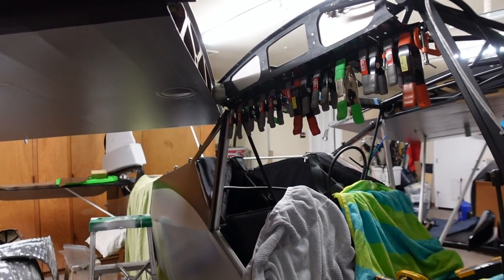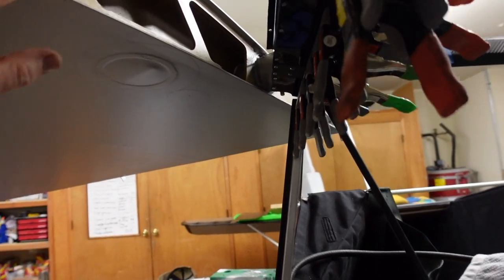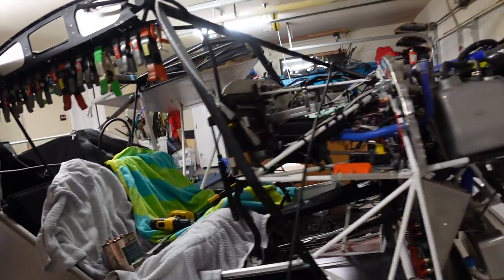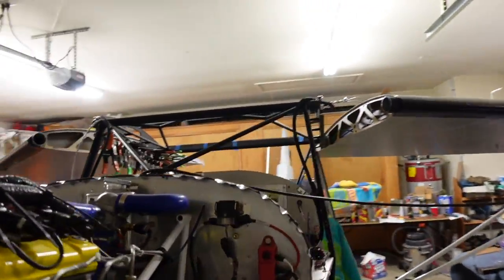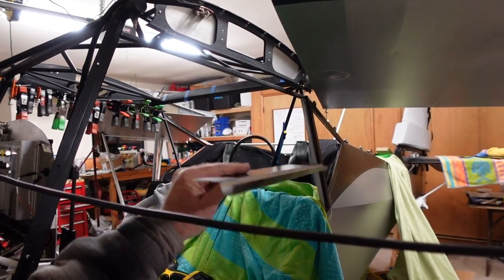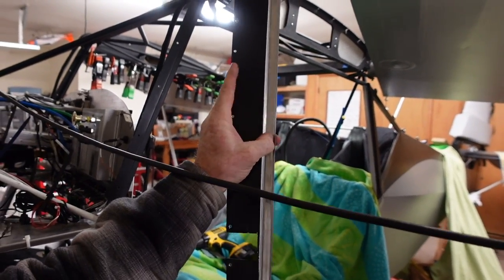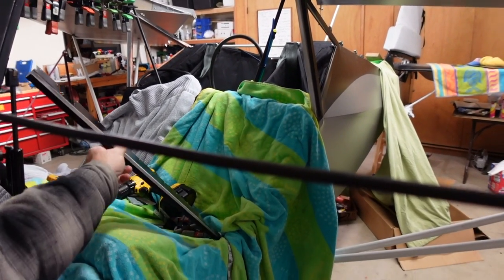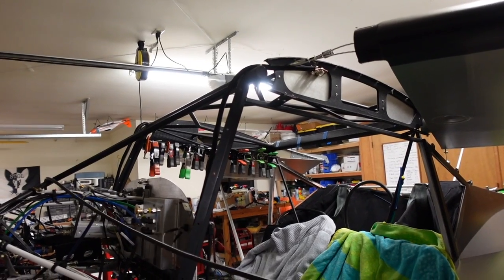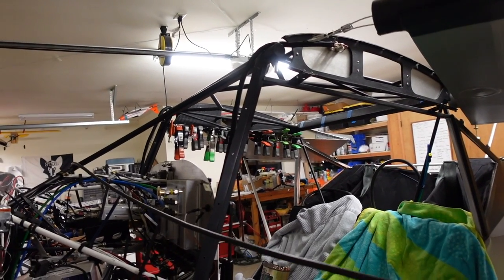Then I can put the hinges on and the doors can go on — though I'm not going to mount the doors yet. What I still need to do is run the fuel lines up and the sight gauges on the wing, so I can start in on that tomorrow while I do the other side and let it dry. This one's all drilled and deburred. I sanded the inside of these slots with 120 grit to get some grip there for the glue, and did the same thing on the bar it's going to glue to. I did use micro balloons on the other side so I'm going to pull all those clamps tomorrow, make sure everything's seated properly, and then go ahead and do this.